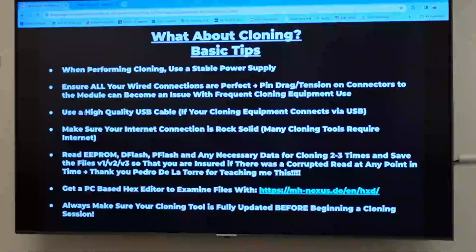Wired connections: if you're doing a lot of cloning, you'll find that with lots of little connectors sliding onto pins, what happens when we depin and repin connectors all the time? We lose pin tension. The T-Ninja box comes with a bunch of awesome leads, but after cloning a bunch of modules the pin tension's not so good anymore. Either replace them or repair them. If you find yourself doing a large volume of a specific module, make or buy a bench harness — it won't have the same fatigue and wear issues.